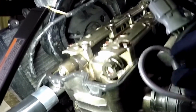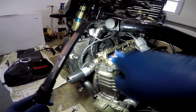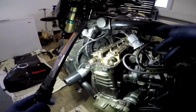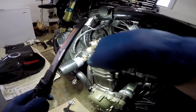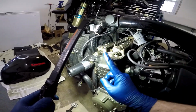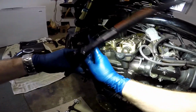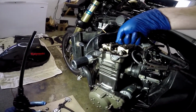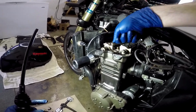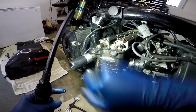So what we need to do with our feeler gauges for each set of valves in the engine, intake side, exhaust side, is rotate the engine manually so that the pointy end of the lobe, this part right here, is pointing directly away from the bucket. So 90 degrees away from the bucket. And then get our feeler gauges underneath there to see if we can feel what the gap is between the cam and the valve.